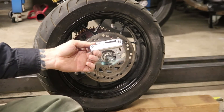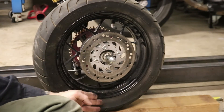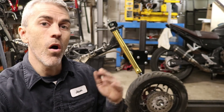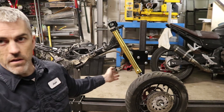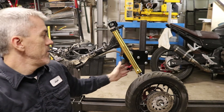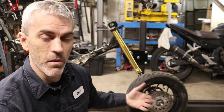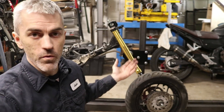These levers aren't actually very long, so it's only going to move my wheel out maybe an inch. That's functionally equal to the tire patch moving forward one inch, which should put me at about three inches of trail. At the very least we should end up with two inches, which is within the standard limit. I expect it'll probably be somewhere between two and three inches in reality. I'm confident that 27 degrees of rake will work out well. There's also the clearance between the forks and the engine, but that's hardly going to change at all, so I'm not worried about that.